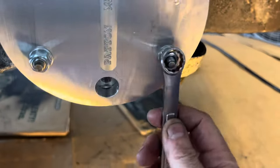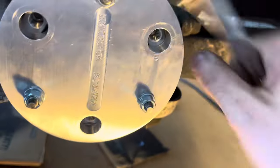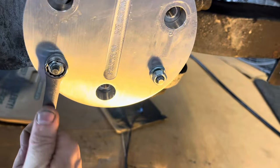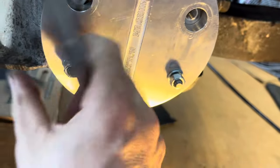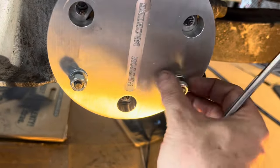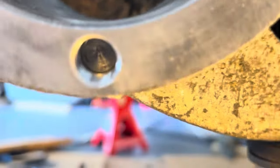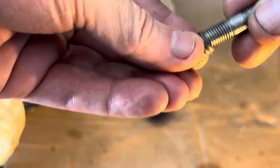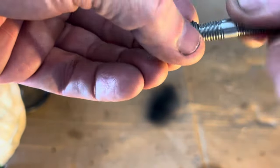Things are vacuumed up and cleaned up. Now it's safe to remove the plate and insert the first three keen inserts. See how they sit below the face of the trailing arm — that's where you want them. These are nice large threaded holes now. Spot-check that your studs actually do screw into the insert — they do; it's a nice tight fit.